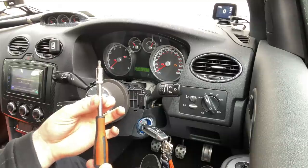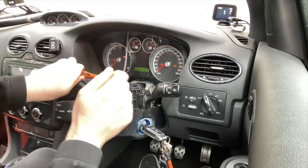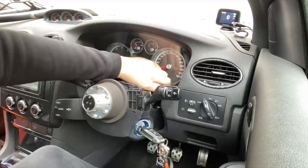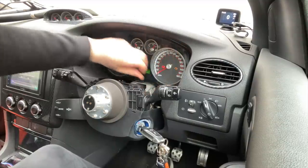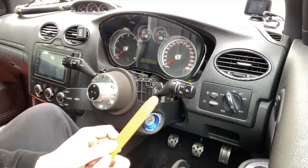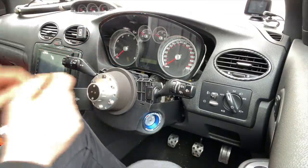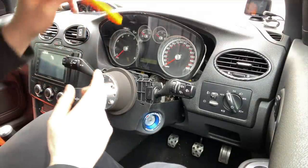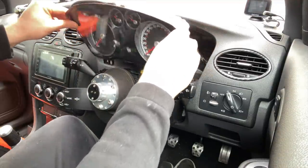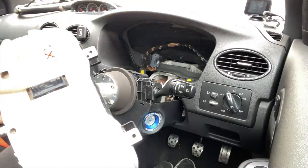This is the first time I've done this. Obviously we've got the correct tool — there's only two small holes. That was easy; let's hope it comes out as easy as the bolt did. I've already taken this off camera. I rang the guy that provided the actual clocks to get his professional opinion. What you're going to want to do is take a plastic removal tool and stick it directly in the middle, then you release the clip at the top and just pull it out. Once you've done that, the clocks will come out and you'll see there's a little connector with a little black switch on it — you just lift it up and pull it right out, and it's that simple.